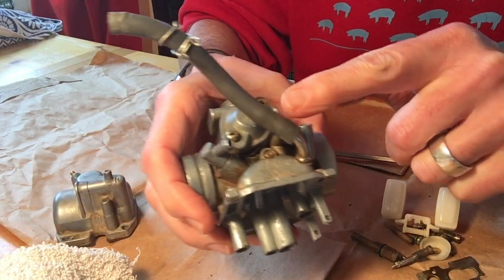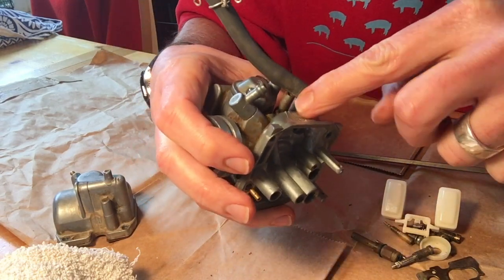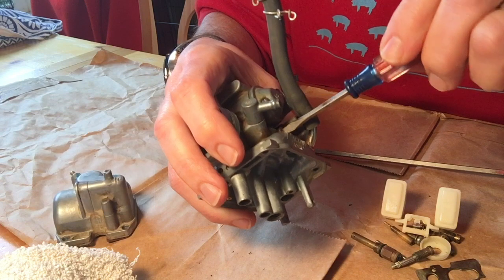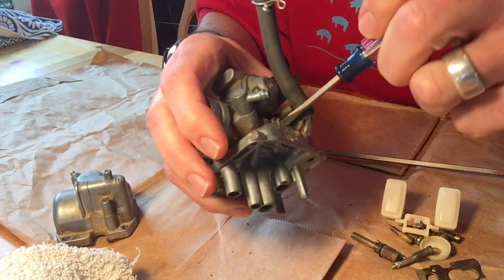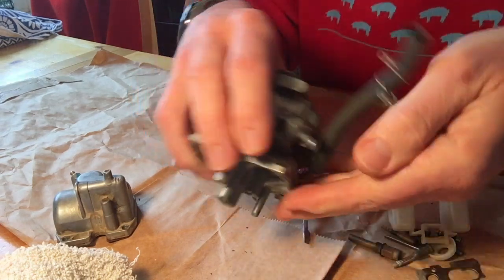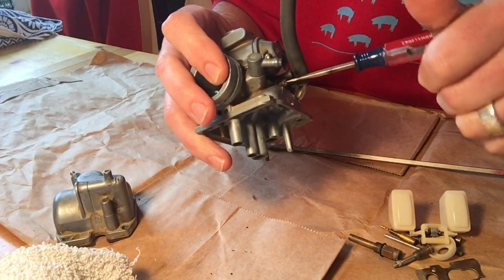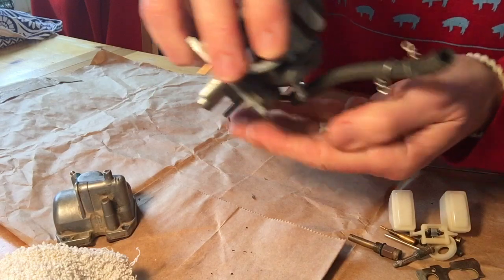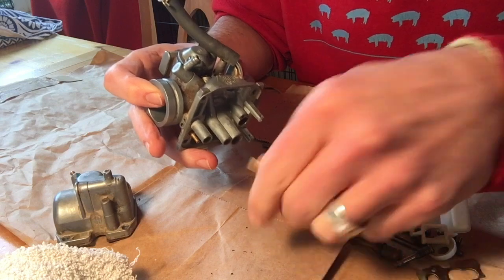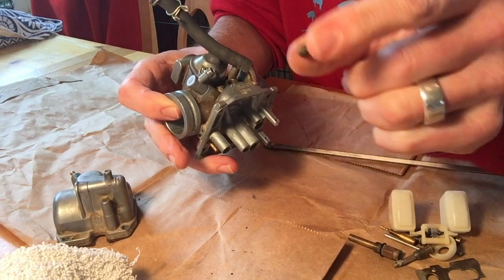You can see that we're on the fuel on-off switch side because we still got the hose attached. And we've got that little standard head right behind there. We want to get at that, so we're going to start screwing that bad boy off. Over and over again, they say that no matter how little the dirt is, if you get dirt in your carb while you're trying to clean it, you may run into exactly the same problem or a brand new problem when you go to rebuild it. So you want to make sure your surfaces are clean and that your carb is clean.